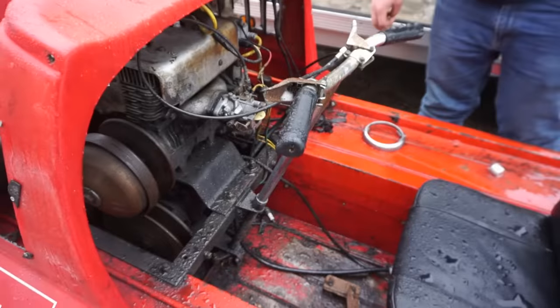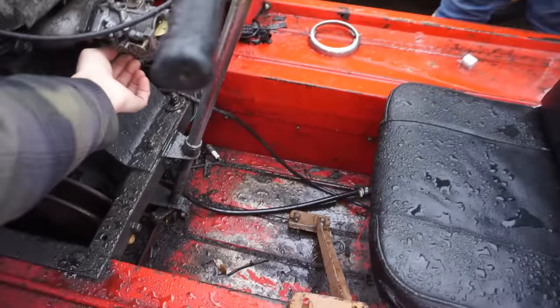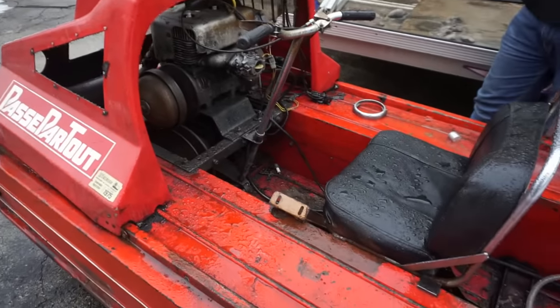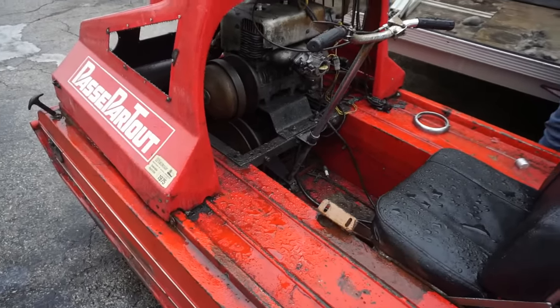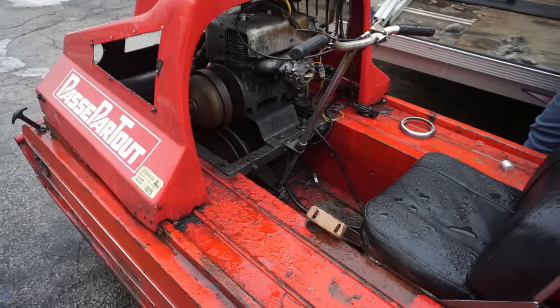You got compression. Okay. About 150 pounds each cylinder. Okay. So the pump still works here? Yep. The vacuum pump should still work when you hook it all back up. Okay. All right. Yeah, that was my first thing when it started running a little different. I'm like, oh, please tell me I didn't pull this up.